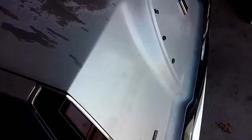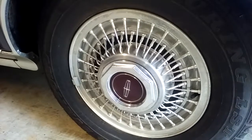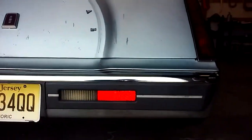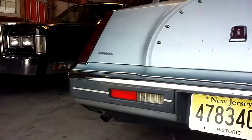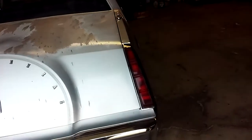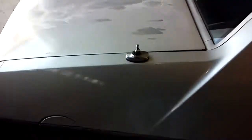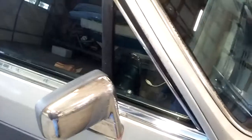The wheels — I actually took these apart and polished each one of those spokes by hand. It was a horrible job and I don't recommend the experience, however they do look a lot better. Better taillights — those are nice junkyard parts. The rear bumper is also a junkyard donor part; the original chrome was wasted. Reverse lenses are also from the junkyard. The bump strip is the original from this car — the junkyard one was messed up. The antenna has been fixed too — the motor inside was all gummed up and the mast was shot. I had a new-old-stock 1984 mast, rebuilt the motor, and repaired the burned-up relay.